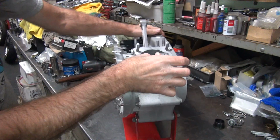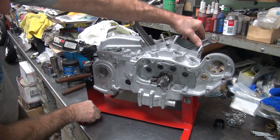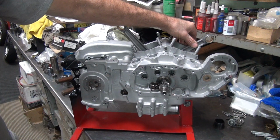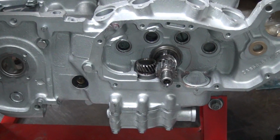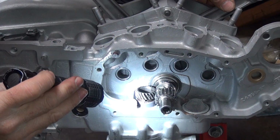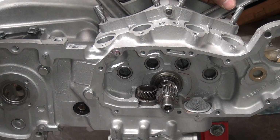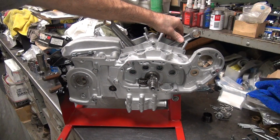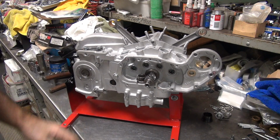So go back around. We're holding the rod. And I don't know if you can see in there, but the hole is where it is. The camera wants to move. There's the hole. It's just slightly forward of center, toward that way, which is our better way of being. So that's because we're half an inch off up on the timing mark. But that's okay. That's where we want to be. Alright, let me get all this cleaned up. We'll come back and do all the cams.